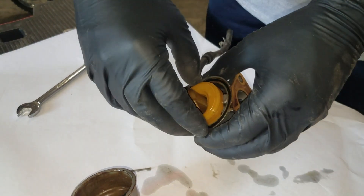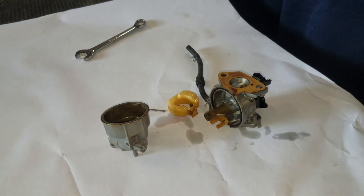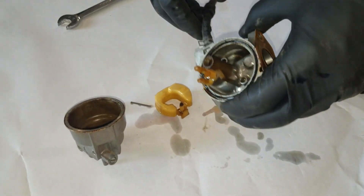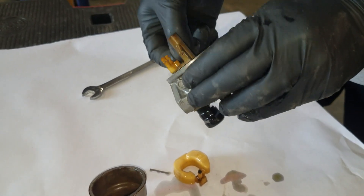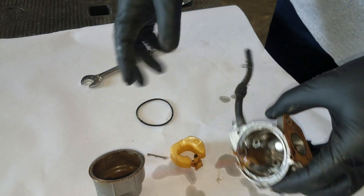What we're going to do is get this carburetor disassembled and soak it in Purple Power. That's something anybody can go buy — you can get it at Walmart. It's one of the few things I've found that will eat the old fuel and actually help dissolve it. It takes a little while, but if you do have some, you can also buy Berryman's carburetor cleaner at the parts stores, but it doesn't dissolve it instantly. With Purple Power, you can soak it really good — give it six hours or a day — then pull it out, wash it with water, and blow it out with compressed air. That's really the best way.